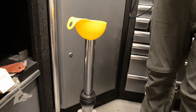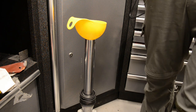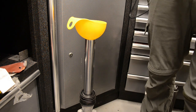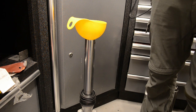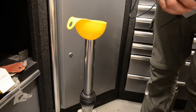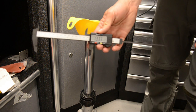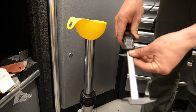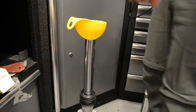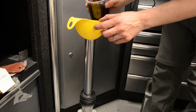Lastly I'm going to put the oil in. Sorry about the mess up on the tool — I wanted to have a complete video. This is an '88 and I checked the chassis number, so this is a J model. The book says the J model should have 133 millimeters, so there's 133 — take that off it, 133. That's the level of oil. The shock should be more or less a full 500ml — we'll see.